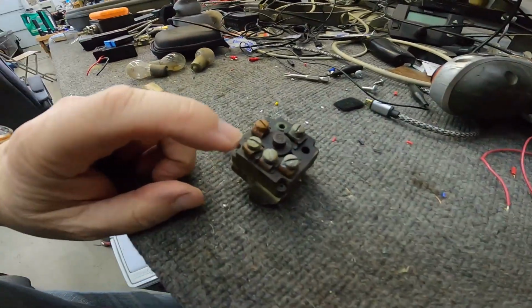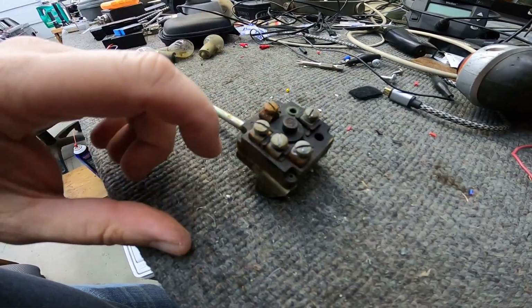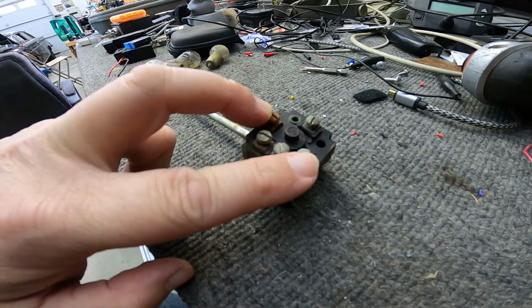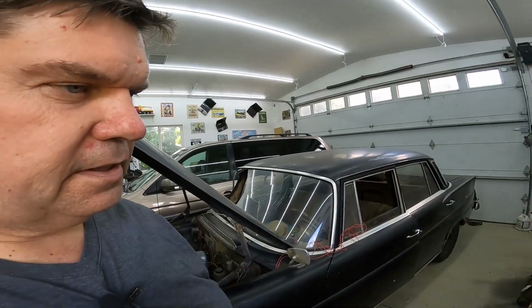There were other contacts for that. So you have common, right blinker, left blinker, and these two were the connection for the high beam, but it's not activating. I didn't put an ohmmeter across this. I don't know if that's the problem, or if the relay that is supposed to flick it is not working, or there's a bad connection in the connectors. A lot of these connectors have a bad connection, because while troubleshooting the rest of the lights, those Mercedes ones, the socket and pin, I've noticed they have just bad connections.